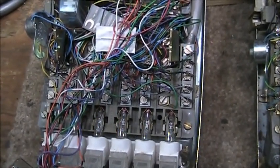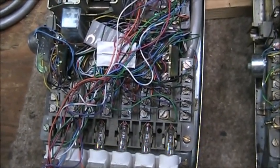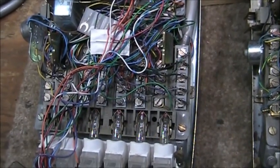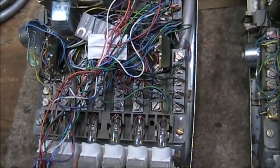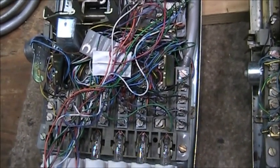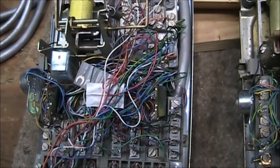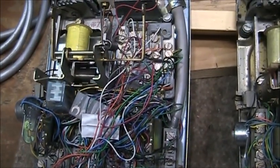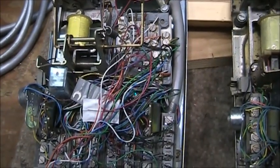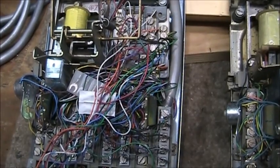The key strips in these two telephones are identical — they're what's called a 636A. You cannot connect two 2565 telephone sets on the same cable using a CPC adapter. If you do, you will have troubles unless you disconnect the violet speakerphone leads inside one of the two telephones. This also applies to the 565 series of phones.